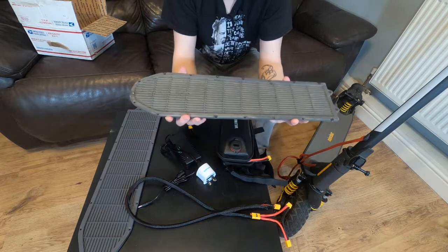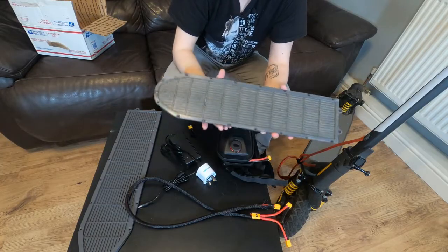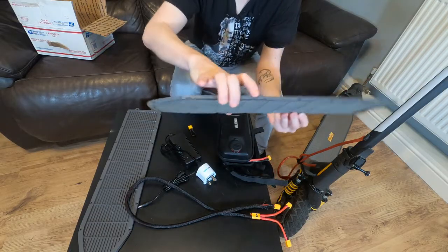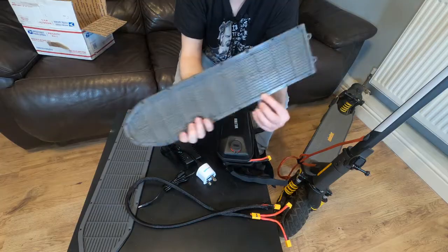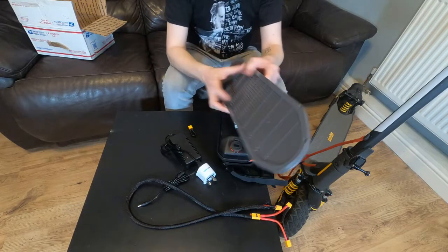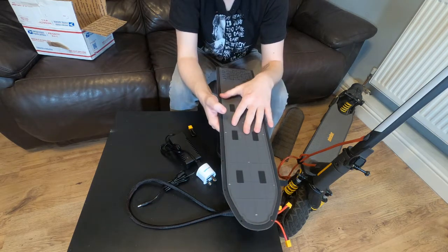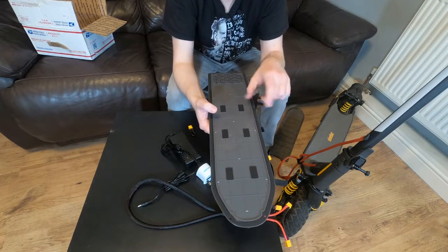You've seen it in plenty of my other videos, it's nice and easy - around 18 Torx head screws. Pull it out and as you can see from this one it is fairly damaged, fairly grimy, and on the corners you can see it start to crack. So I don't want any water ingress getting in there and I want a fresh new one to go on. So I've gone ahead and bought myself a new one. This one already came pre-lined - you can buy them separately with just the plastic cover, which is a little bit cheaper, but it's just easier to buy the whole thing.